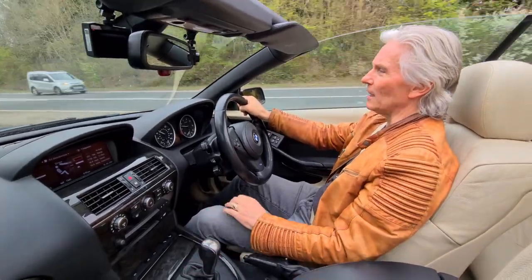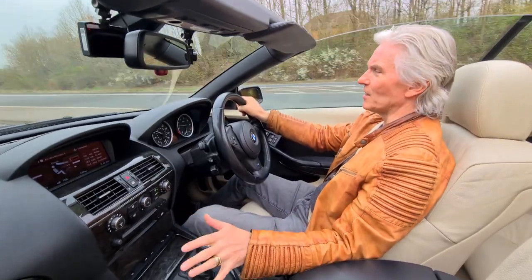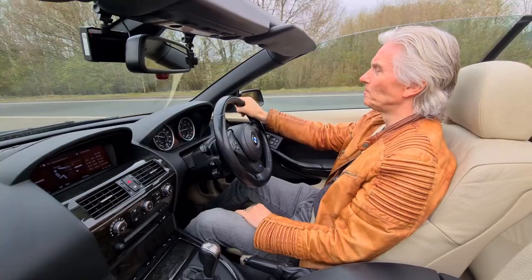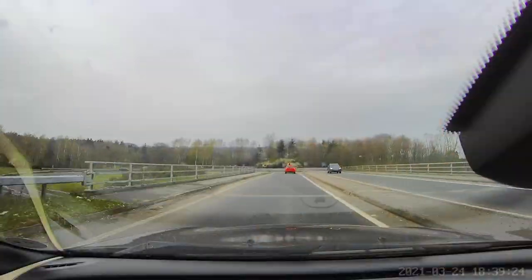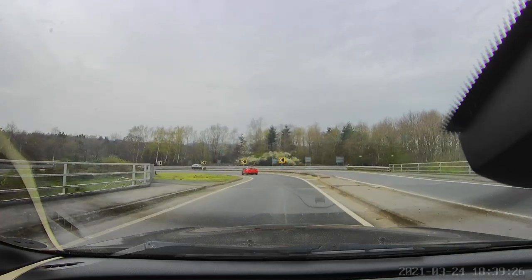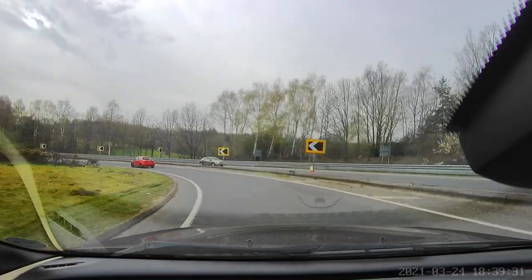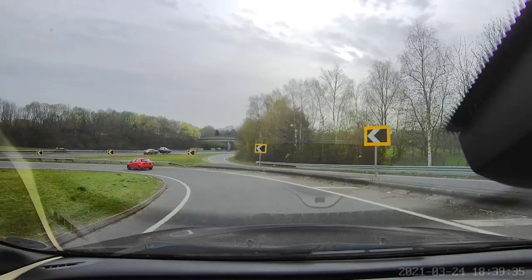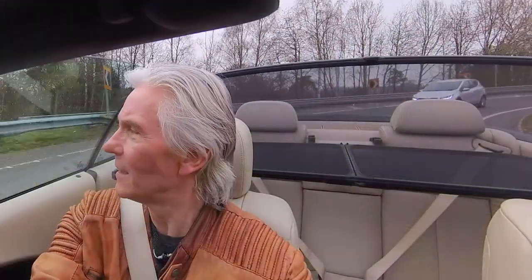And also what I've done is recondition the seats. And you need the seats to be in good condition to have the top down, because obviously the sun gets on them. So yeah, those two things. The soft top, I will warn you, don't take it trivially, because it took me about 4 days to do it. Because you've got to use the special compound to scrub it all down. You've got to put 3 coats of black on it and then 2 coats of waterproofing on it. Yeah, it's not easy, not a trivial thing.